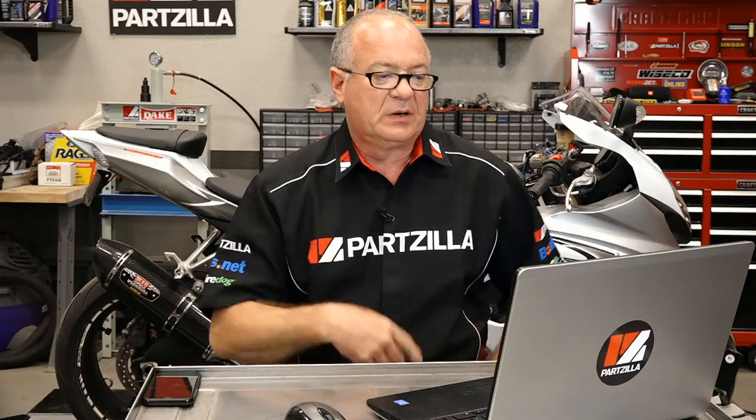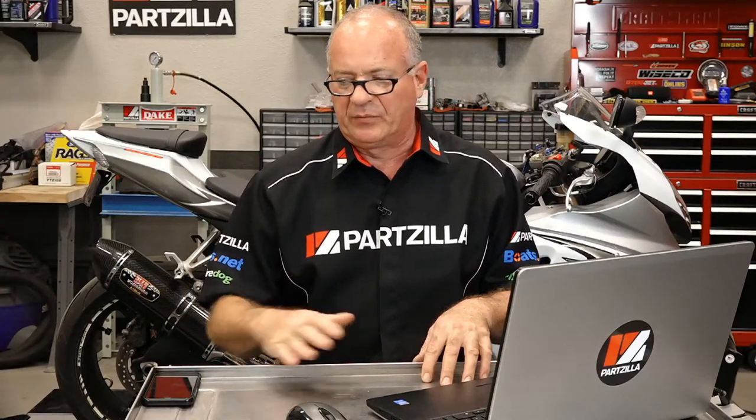No and yes, especially with a PIA light, regardless if it's a halogen or an LED, I'm betting it's probably an LED, you do not want to tax whatever machine you're installing this on with an additional amperage or load, because the manufacturers designed those wires and those circuits and those fuses and those relays to deal with what the machine had on it when it rolled out of the factory.